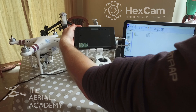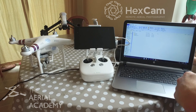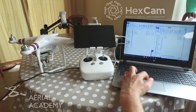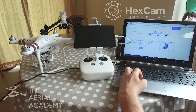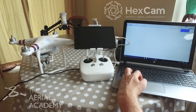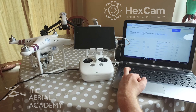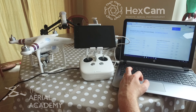You don't want the transmitter on during the update process for the aircraft itself — you purely want the aircraft on on its own. So I've turned everything else off. Grab the micro SD card reader. I've already downloaded the correct firmware from the DJI website. Get to the DJI website, find your aircraft — make sure you've got the right one. In this case it's Phantom 3 Professional, so go to Phantom, Phantom 3 Series, and Phantom 3 Professional. Scroll down to Downloads. I'm updating version 1.9.6.0.